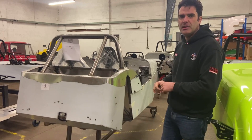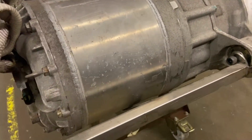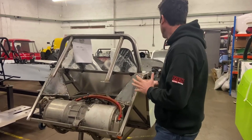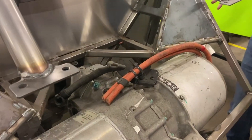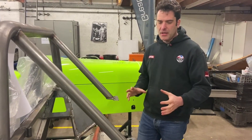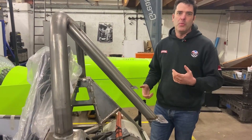What we've got here is a standard-ish Zero chassis where we've put in the Tesla Model S motor. This is the large unit from the Tesla — just a donor unit that's a bit rough, but it's going to be fully cleaned up. We're also going to put a limited-slip diff in it among a few other things. You're looking at about 470 horsepower up to about 645 horsepower depending on the spec and the ratings.